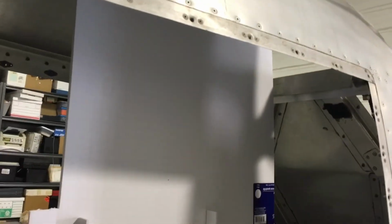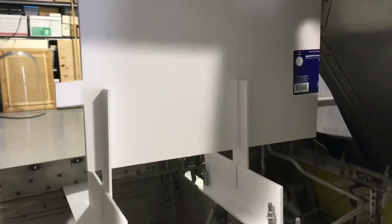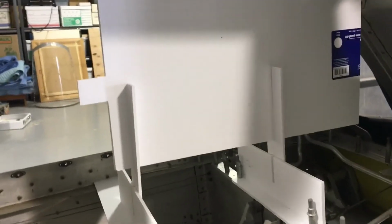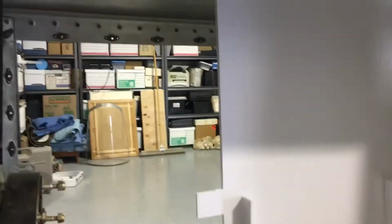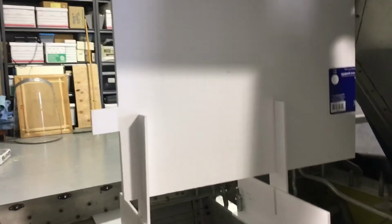I thought I would also point out that this engine is actually just a 3-cylinder version of a 2-cylinder that has been used in this aircraft. So the dimension I'm really dealing with is just the fact that it comes back about 3.5 inches further rear than the other engine probably would. And so it becomes very critical to mount that area right there where there's a drive pulley for the water pump that's going to come up against that one cross member that right now is where my seat belt is. That's probably the one critical adjustment I've got up at the top.